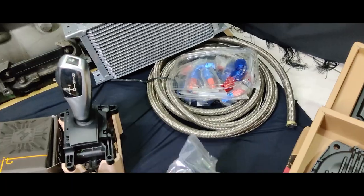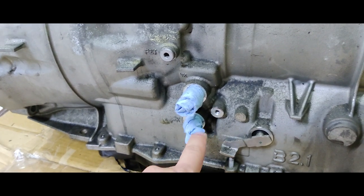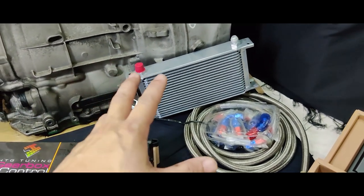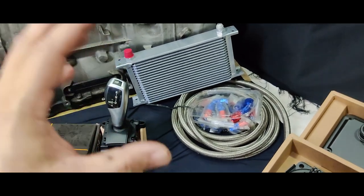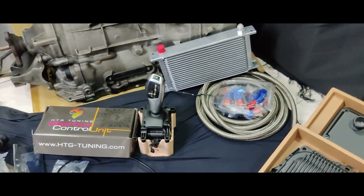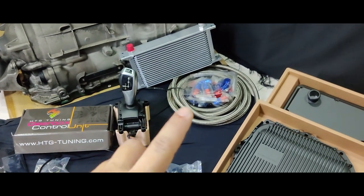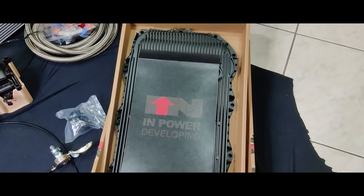Next is the cooler system. This is the Domi Works adapter for the oil cooler — it's a dash-8 AN kit. The oil cooler I'm using is a bit small in size; I might go up larger but for now it'll get me going so I can monitor temperatures. I may switch to PTFE lines once I finish mocking up with these.